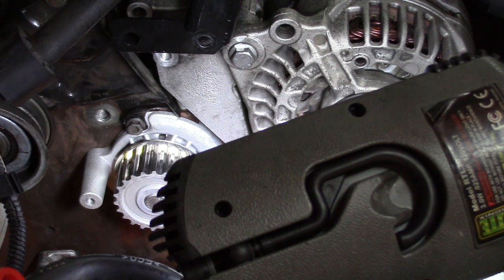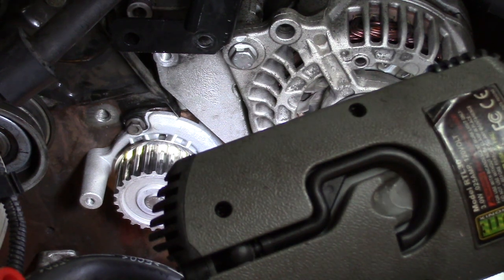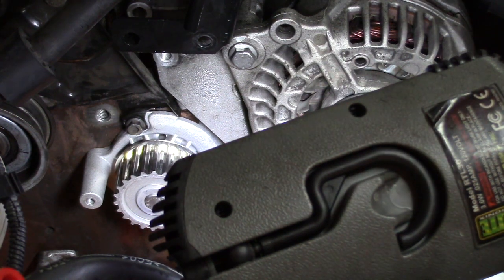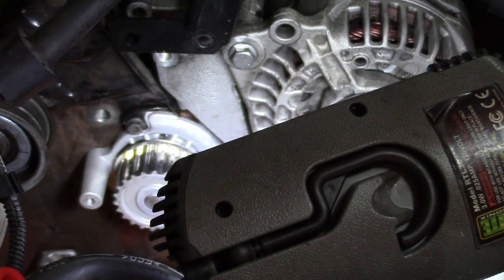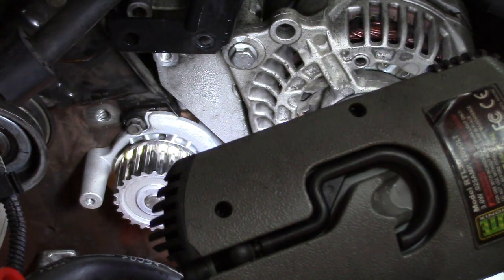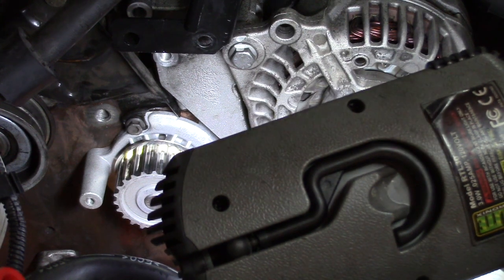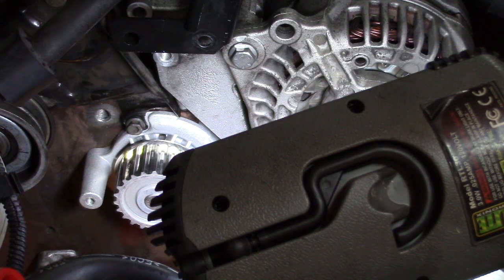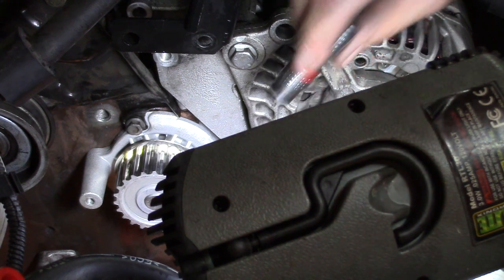The new water pump is in. If you do not install a new water pump and tensioner with this new belt install, you are doing it wrong. This car had a component failure for the timing belt, so it is critical that you change the water pump and tensioner. The instructions did not include a torque setting for the water pump, surprisingly, so I had to look it up — it is 15 newton meters. A newton meter is approximately nine inch-pounds, so we're looking at about 130 inch-pounds for the torque setting.